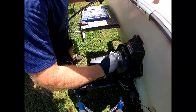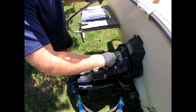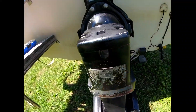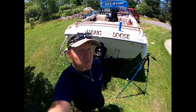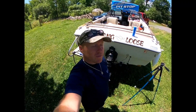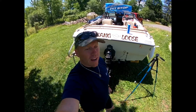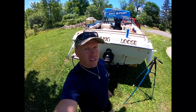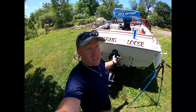Just clean up any oil that's left down there. As you can see, it's all back on there now — nice and tight, new o-ring, and finally something very simple. If you notice you have oil leaking out of the top here, it's just a little o-ring. Make sure you get your old one out — you don't want to leave that in there getting caught in the gears. Mine was broken in half when I pulled it off, and the other part may have already been in there. Just make sure you get the whole o-ring out and inspect things while you're in there. You could even look at your gear oil — mine looks good because I just changed it not even two weeks ago.